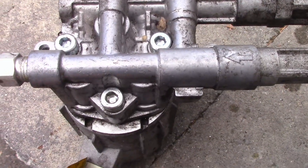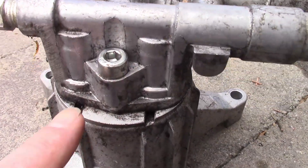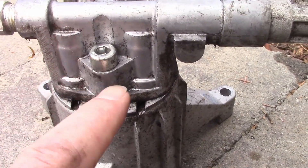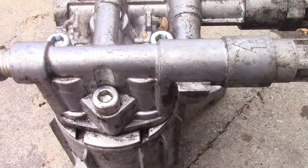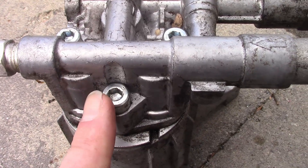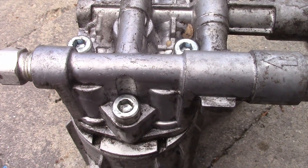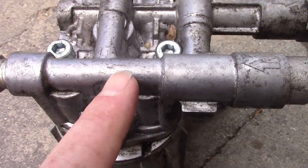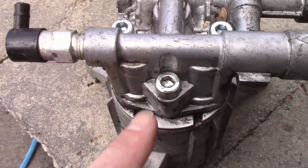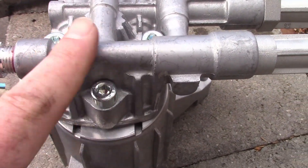Another thing about the pump — if you can just see these hairline cracks in here, there's another one that runs up over here — that's where the leak is coming from. The trick is that it doesn't really leak until you put it under pressure. With the hose connected and the machine not running you wouldn't see any leaks, but once that pressure kicks in, all that water starts to come out of those little cracks. On the new one you don't see any of those hairline cracks at all.